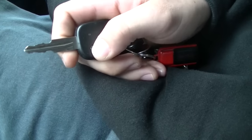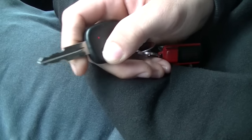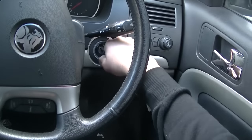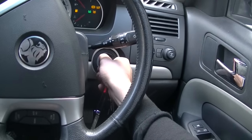If the light is coming on when you press unlock but it isn't unlocking your car, this is how you fix it. All you have to do is hold the unlock button and turn it to on, and hold it for 15 seconds.